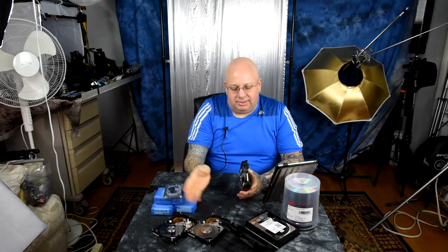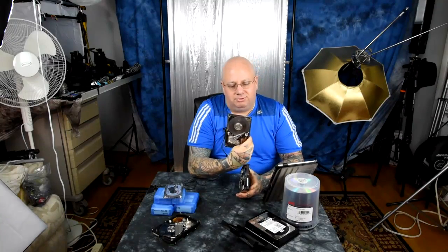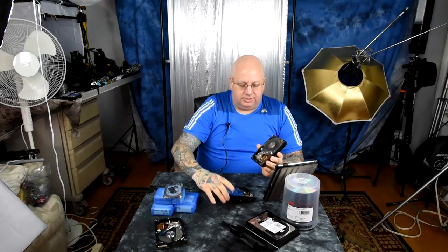Even though I've got hundreds of working hard drives, I've also got a whole collection of hard drive magnets I've yanked — I'll sit there watching TV and unscrew hard drives. These glass platters are great for photography because they're transparent. The ferromagnetic layer that maintained the data is completely powderized — it got spun around and when I took it out, all that data-maintaining ferromagnetic material turned to dust and slipped right off the platter. That's why this one is clear and the other looks mirrored. These were actually server-grade IBM drives.